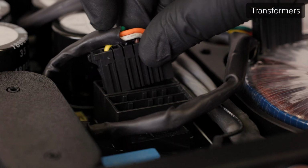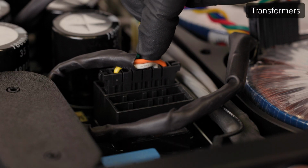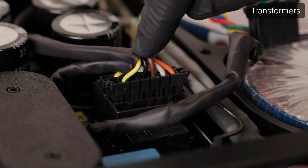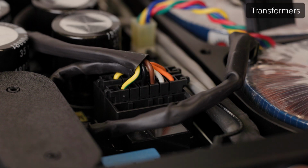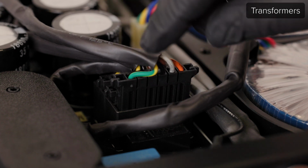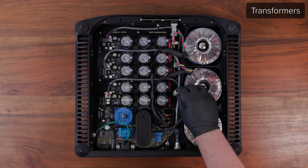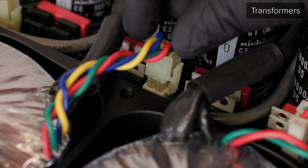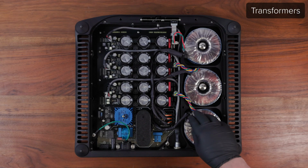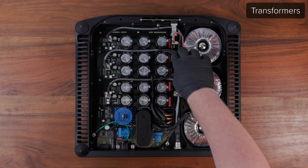Now reinstall the black connectors. They should slide in easily and make a crisp clicking noise when fully inserted. Reinstall the smaller white connectors by matching the latching portion on the side of the connector and pushing down till the latch closes and the two bodies meet without a gap.